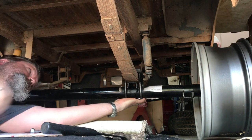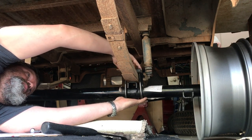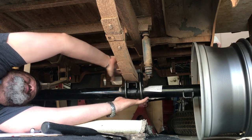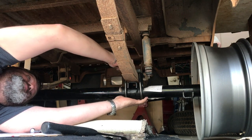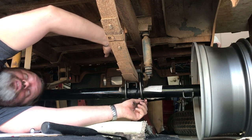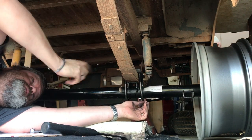The shocks are still just hanging there, so I still have to weld on a mount for those. Next up, I'm going to need to cut these off — these were like a limiting bar or bump stop of some kind, but they are definitely going to be in the way. I think it's because with the previous axle, that weird drop axle, it didn't have a plate sticking out the sides like this. I'll probably cut them up about three inches.